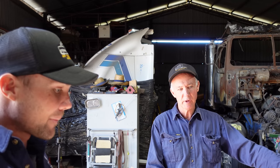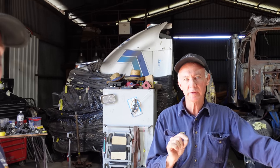All body shells, the way they're put together, that's why they're spot welded and they've got joins where they have the joins. They're not just thrown together. It's all about strength, and the car's got to flex and move. When you're cruising along on a nice highway, that whole car's got a slight movement all the time. Everything's moving to a degree. And when you go into a fairly decent gutter, or up across a curb, the whole shell will twist and flex. That's why they're designed the way they are, to move.